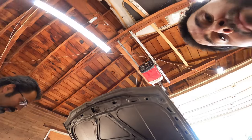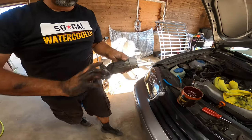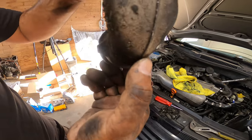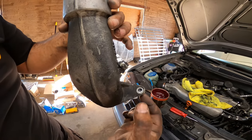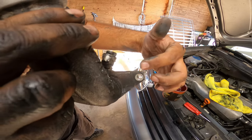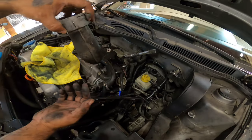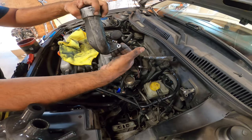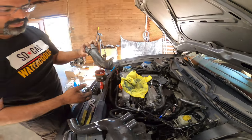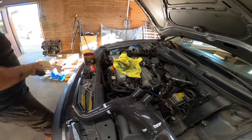This is the hole with the five millimeter Allen head that we had to take out. This goes into the turbo like this — we had to raise the car and do it underneath the car. It's a lot easier with the flat screwdriver right here. You pry in between here until this pops out, and then when you're over here you're going to need two hands on top. Hold this while you're wiggling on the bottom. Put your fingers down here, pry away from the block, and then push it up until it pops out. And that's it. You need to take off the hose that's on here, and you're going to need that to redo it — use it for the next one.